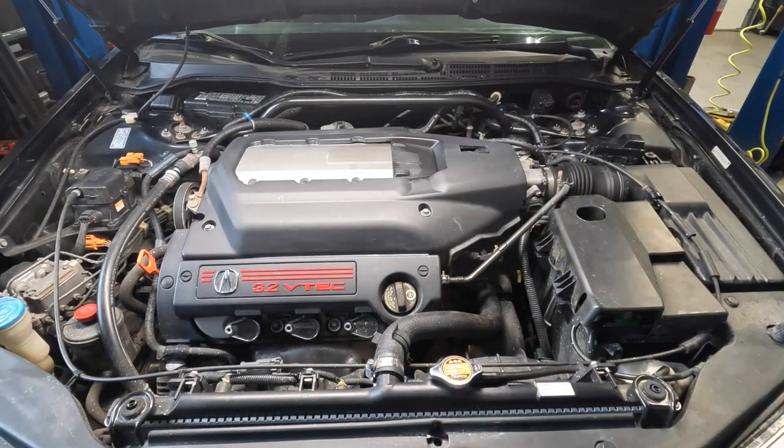Let's go ahead and take a look at the cooling system. Just like the customer told me, he had water inside of the cooling system due to a leak. Now that's not the worst thing you could do to an engine, especially in summertime — if you have a leak and pour some water in there until you can get it into a shop, that's totally fine. The problem comes when you leave that water in there too long and throw off your coolant balance. Normally it's supposed to be 50/50: 50% water, 50% coolant, which won't cause corrosion inside your engine.